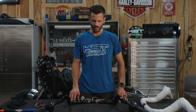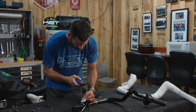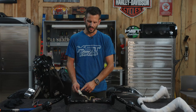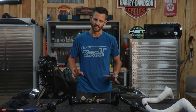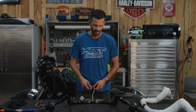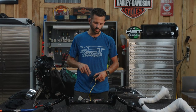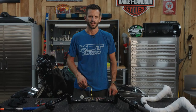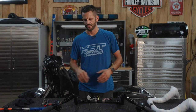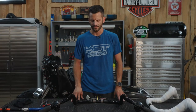So we're ready for our internal wiring process. This is a little in-depth — you've got a lot of depinning to do. I highly recommend taking pictures of the wire locations or drawing a map. Just make sure you know which way the plug is oriented, otherwise you can repin the wires backwards. On the throttle by wire, you're going to have six wires — two red, two black, and two white. The two different groups are in a yellow sleeve and a black sleeve, so make sure that's oriented correctly.